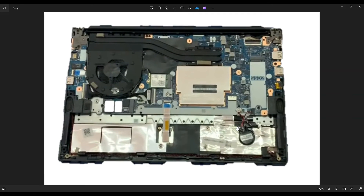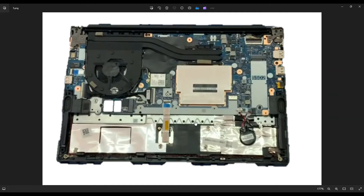After you get the battery removed, the computer is now a little safer to work on. This is your RAM right here — this thing comes up very easily, and this is your one single RAM port. It has a metal arm on either side that's spring-loaded and holds the RAM into place. To get the RAM out, grab both of those and gently pry them apart away from your RAM stick, and the RAM stick will release. Most times it will even pop up a little bit, and then you can slide it out. That's how you access and replace your RAM.